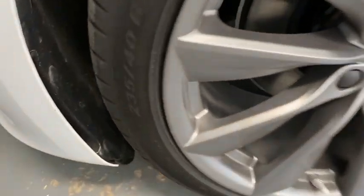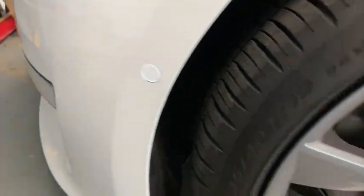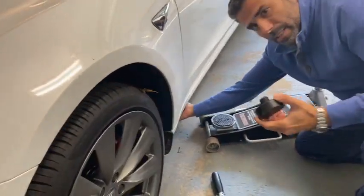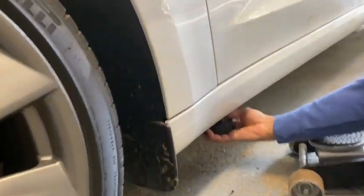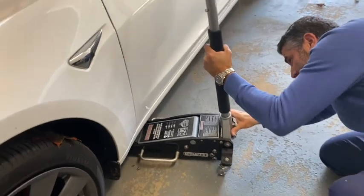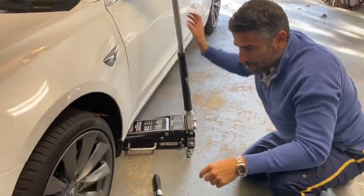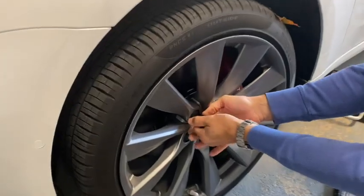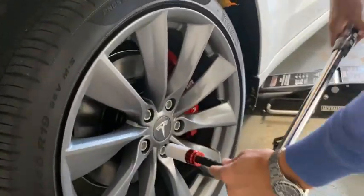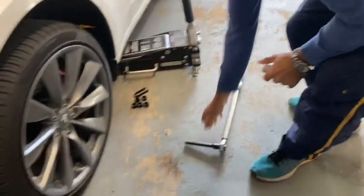In order to jack up the car you have to make sure you have one of these - it fits into a hole under the body here. Samuel, you can take a look - this fits inside that hole right there, and then you put your jack underneath. There we go. Now we can start lifting the car. Obviously first we have to unbolt the tires, so we're just loosening the lug nuts, then I'll jack up the car.